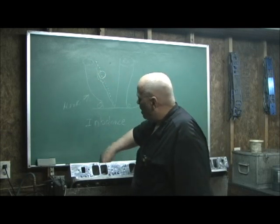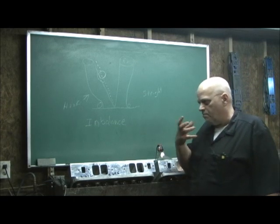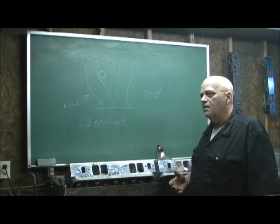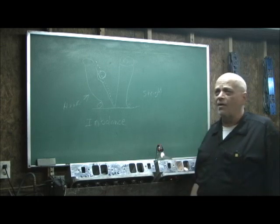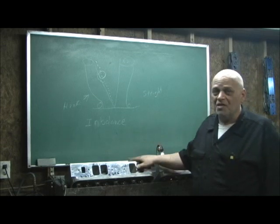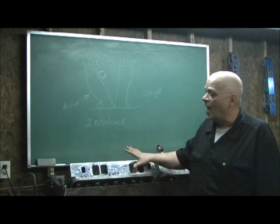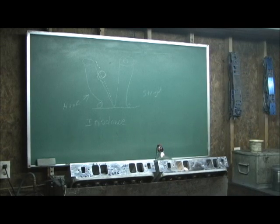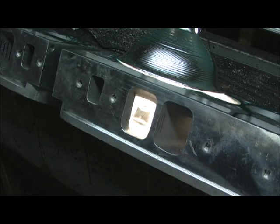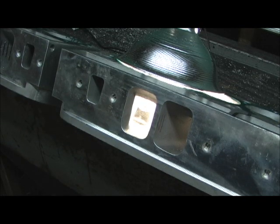I just wanted to go over that and touch on it with you. Now I'm going to bring the camera in and show you a little interesting tidbit. I had to break the sonic checker out to go in here and check this, and it's going to be hairy - it's a major problem in the head on high lift airflow and we've got to do something about it. Raymond, we've discussed this quite a bit on your heads, and I'm just not going to worry about it anymore - I'm going for it. I want you to have the power and I know we're not going to have a problem if we bust through. I've got one of the last ports here that ain't got much material out of it, but the guides and the roof and all that's been taken down.